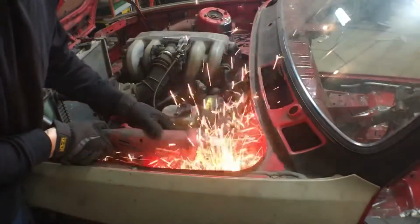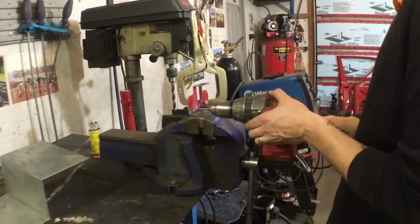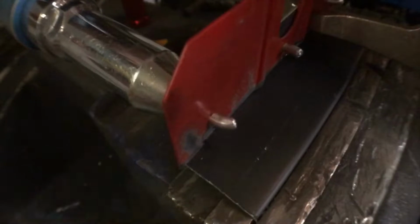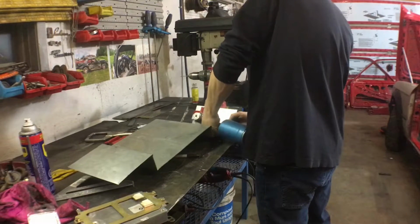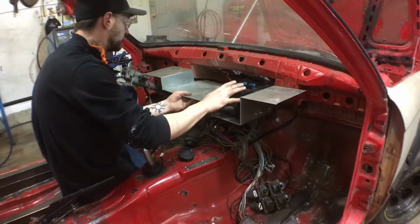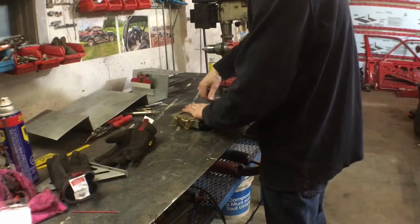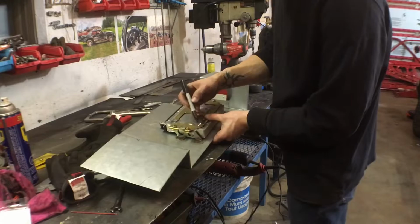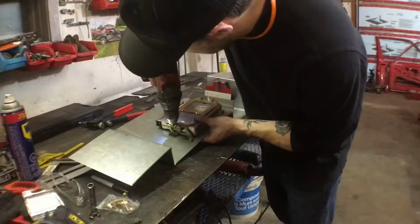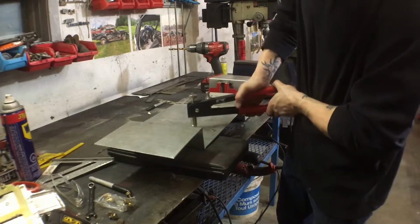To mount the fuse block under the dash, I'll first remove the original mounting bracket from the engine bay so it can be modified to fit inside the car. Once I have decided on a location, I'll fasten the bracket to the pan using pop rivets and tack welds. I will be fastening the ECU to the pan as well after trimming some of the bulk off of the mounting bracket and carefully marking the mounting holes without a tape measure. Rivet nuts are a clean and simple way to fasten the ECU.